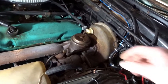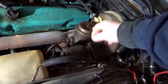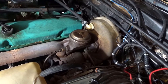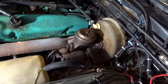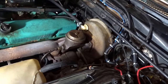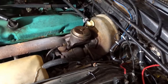Single-circuit brakes do make me a bit nervous. A younger me probably wouldn't have bothered, but dual-circuit makes me a bit more relaxed. So you go online, you look for an aftermarket kit for a C-body for a boosted dual-circuit system, and there don't seem to be many advertised. It's as if C-bodies don't really get much love in the aftermarket parts department.